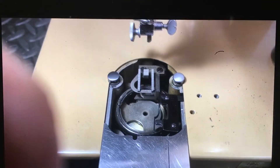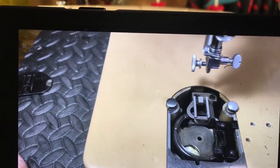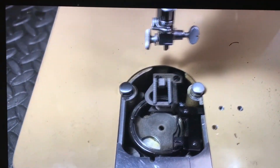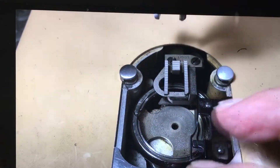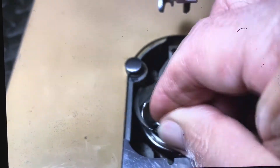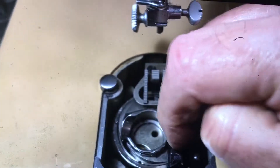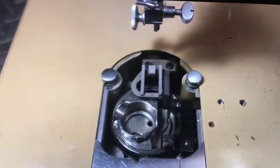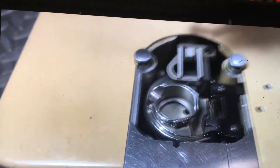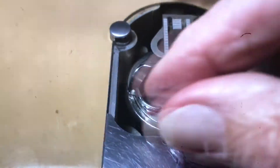Here's what we found first: the bobbin case was thread-locked. Every machine that's ever been made — that's not a serger or chain stitch — thread-locks when thread gets caught up between the bobbin case and the hook. It'll get caught in there and wedge in like it's absolutely welded. This purple piece of thread was stuck in between and wedged inside.